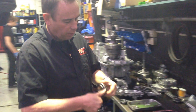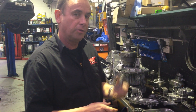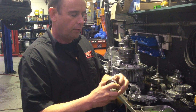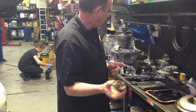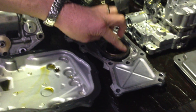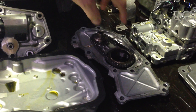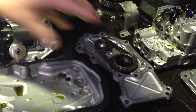This particular part here — you can't hear the noise — but this is the culprit of what allowed us to diagnose the problem with the transmission. This is the noisy input bearing that connects to one of the sprockets, which is on the front of the transmission. You can see this part here, which is what turns, and this has got the new bearing in it now. It drives a little chain off the input shaft from the back of the engine that turns this drive shaft, which then in turn drives the internal oil pump to run the oil through the transmission.